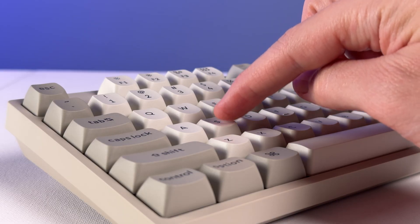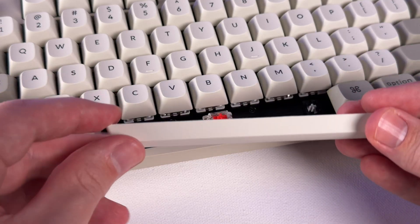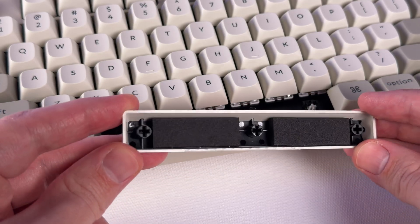The typing here is poppy and firm from that tray mount design. The red switches are smooth with a nice middle-of-the-road level of force needed — it's honestly not a bad typing experience. That spacebar, though, leaves a lot to be desired. If you take the spacebar off, you can see that they clearly made an effort to cut down on the sound by adding in some foam, but it didn't really work very well. The spacebar is still quite loud. Assuming you can get past that, it's a good typing experience especially for the price, but it's not going to compete with some much more expensive keyboards, even those in Keychron's own lineup. I'm going to repeat an experiment I did on a recent Logitech keyboard video — I swapped in a single silent switch to the spacebar to show just how different the typing sounds are if you're able to rein in that spacebar sound. By doing so, the keyboard immediately sounds much more pleasant, and you get to appreciate the sounds of the main keys more than if you have that loud spacebar clacking in between every single word.